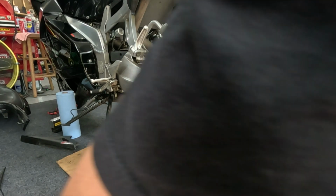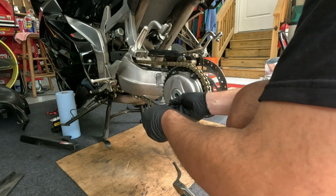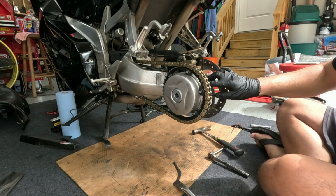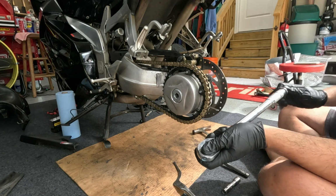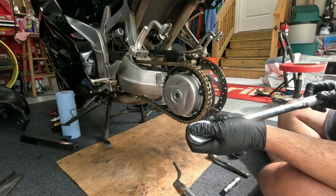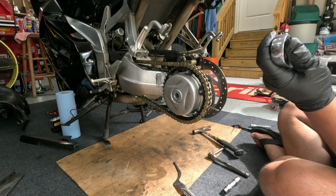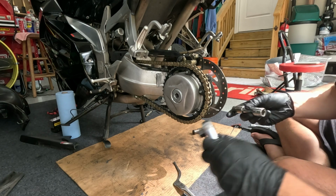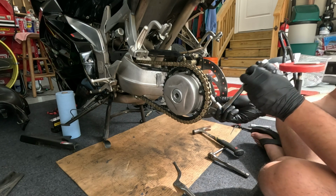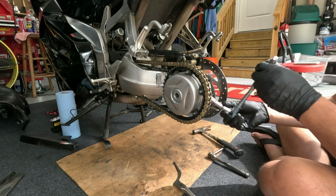We'll put these little buggers back on. Okay, all right, now you tighten these guys down. Manual says about 25.8, I think, foot-pounds, 26 foot-pounds. Not a whole lot. Trick with this is to do it in increments. You don't want to fully torque down one side before you do the other. So as you start to feel resistance, that's when I go to the other one. Yep.